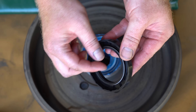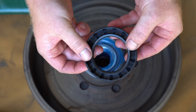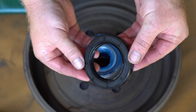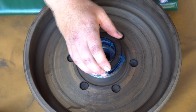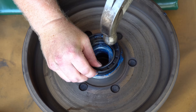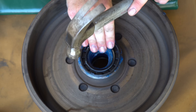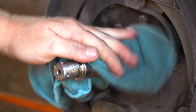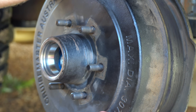We now move on to that inner seal. The seal here is actually metal, however, this particular part has a thin coating of rubber to assist with its sealing properties. A quick tip with the seals and their direction — generally, the opening part of the seal will always face the oil or the grease that it's attempting to hold. The theory here is that as the grease pushes against the seal from the inside, it's attempting to push out the surface and create a better seal. I like to put a little bit of grease over the seal and we can then start the installation by gently knocking it into place, ensuring that it seats squarely and evenly within that drum assembly. I used the old seal we knocked out earlier to assist with this as it just adds a little bit more surface area to evenly seat this new one. We can now clean off that stub axle, coating it with a fresh layer of clean grease.